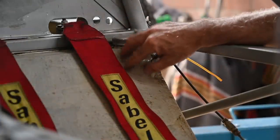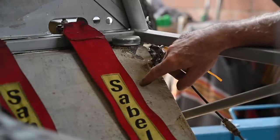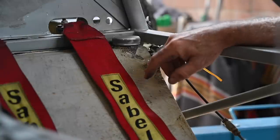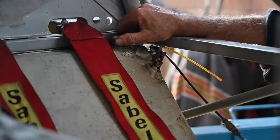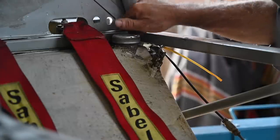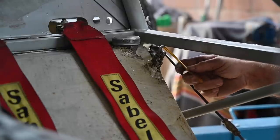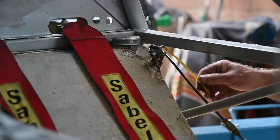Since we're talking about fuel, here is the fuel tank - and that's where the seat normally is, so you're actually sitting against the fuel tank. This is a polyester fuel tank and I don't think it's very resistant to the modern fuels we have. This might have to be replaced with an aluminum fuel tank. I'll also need to make adjustments because I need to take the seat out to fuel it up - I'm going to extend it with a hose all the way to the top. There's also a weird little overflow here sitting on the side, actually dripping inside the polyester ducting for the cooling, which I don't want.